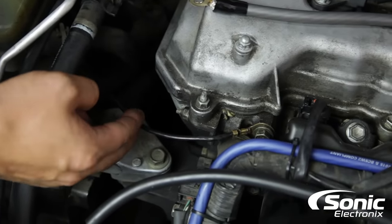Behind me to sum it up, we have a 2002 Ford Ranger pickup. This one's actually pretty easy — the alternator's right on the top of the engine, here's our battery, we can see our factory ground location, and it already has an engine ground and a ground strap. There are plenty of locations to replace or upgrade the ground, and it's easy to run a new charging wire from the alternator to the battery. The foundation of all vehicles is still the same — whether it's a Chevy Cruze, a Toyota Celica, a Jeep Patriot, or a Ford Ranger, you still need to upgrade your battery ground, your engine ground, and your charging wire from your alternator to your battery. I hope you enjoyed the video and the install on the 2001 Celica. For more information and awesome videos like this, make sure you subscribe. I'm Alan with Sonic Electronics — see you next time.